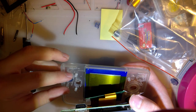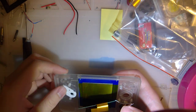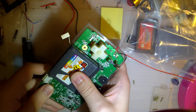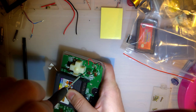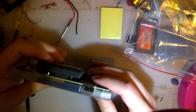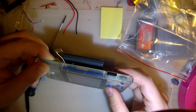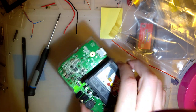Both A and B are the same on Neo Geo — you can swap them if you want, but since they're the same you can't really tell. Then we need Option and Power buttons. And the one screw, because apparently I lost the other one. You've got to decide where you want to put this touch sensor — I think probably right there would be best. But before I place that, let's test this thing out. I'm going to solder the speaker back on, so I can turn my iron off.